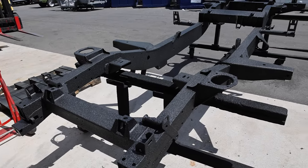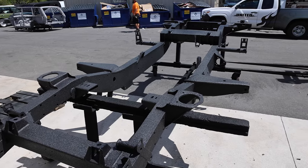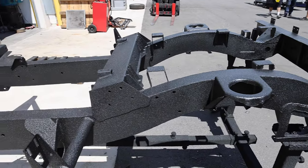This is the frame department and this is where we take all of our restored frames and galvanized frames and prepare them for buildup. We cover these frames in a coating called Raptor Liner, which basically allows them to weather all of the elements — any rock chips, any road salt, any debris — and the frames last much longer that way than the typical Land Rover coating.